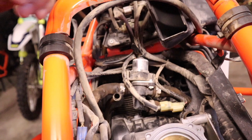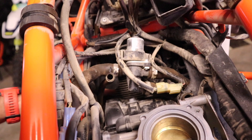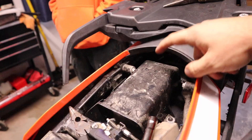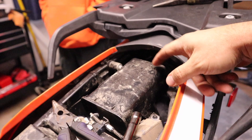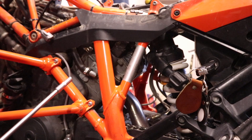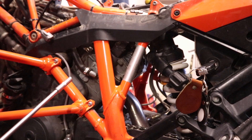Just one other reason to remove this stuff: we're actually going to be taking all of these hoses and the solenoid off, so when it comes time to do valve checks and spark plug replacements it makes it a whole lot easier to get to the front cylinder. We're also going to free up some space in the back of the bike where the charcoal canister is — you can use that space to put tools or an air compressor. It's not a big performance upgrade but it is a great convenience upgrade.